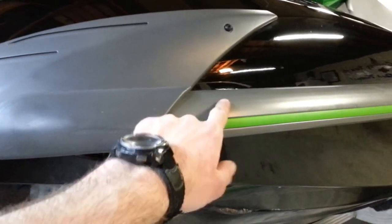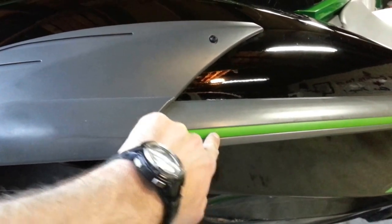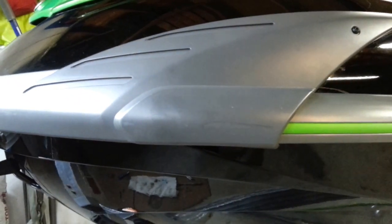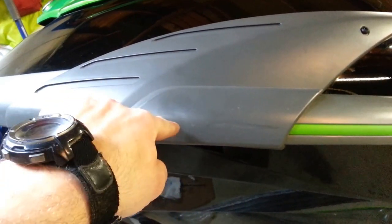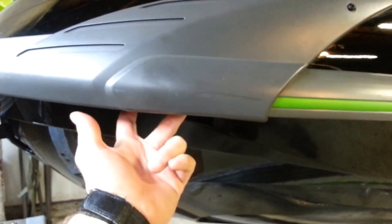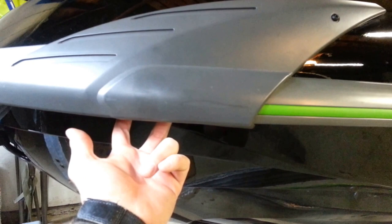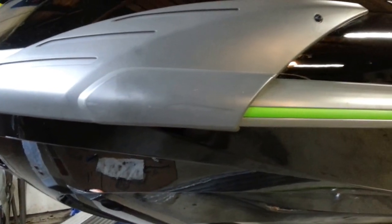We're going to replace this via the front end of the boat. The inner gunwale kind of rests in a channel which is built in and molded into the outer bumper, so the inner gunwale will actually slide all the way down the length of the boat. In the front section, you have two bolts coming from this plastic piece pointing in toward the boat, and you can access the nuts for those bolts on the back side. They will not spin freely — the bolts are held in place by the plastic piece, so we can just take those nuts off without worrying about holding the bolt head.